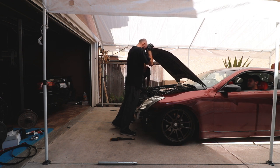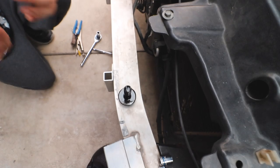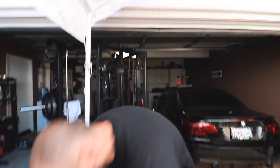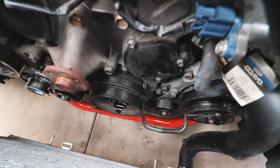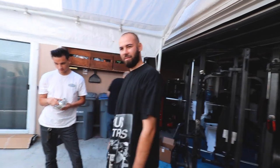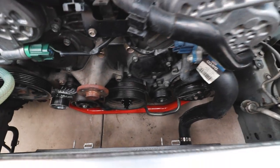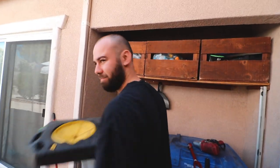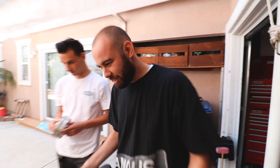Static Dad was able to get it loose - barely any force needed. But there is oil residue right there, so we're most likely going to have to replace the front crankshaft seal. Normally people replace it when they're taking off the pulley. I recommend putting an oil bucket underneath just to catch any drips.